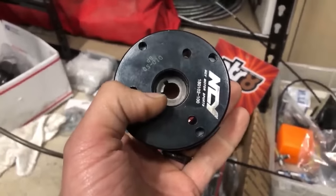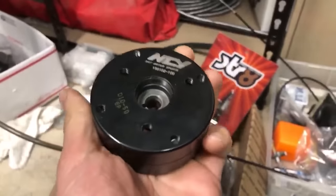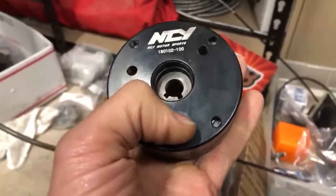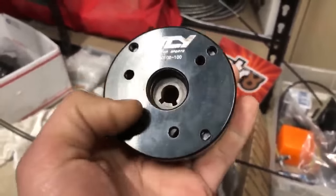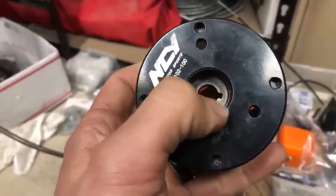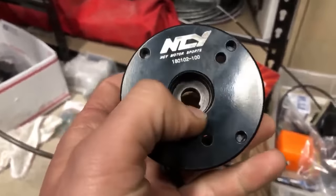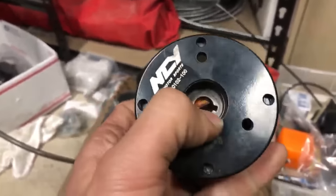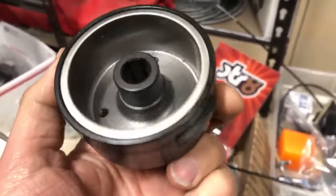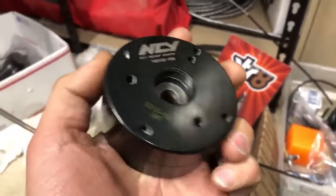So one's going to be for AF18, and DD50 and ZX50. One's going to be for AF16. So you'll see other kits for sale. Tita makes one, and there's all the other Taiwan brands, but know that they don't come with 2 flywheel key slots. They just come with one for AF18, and they'll tell you, oh yeah, you can run this on AF16. Well, good luck running on AF16 because you're not going to be able to line it up. These are plug and play. You just take yours off, put this right on.